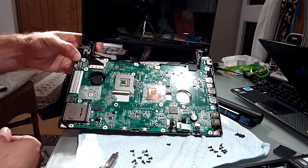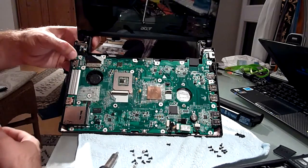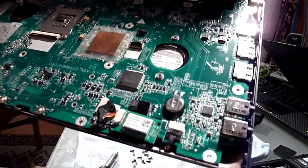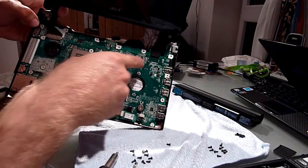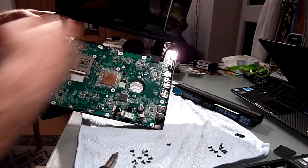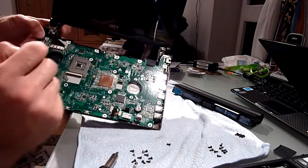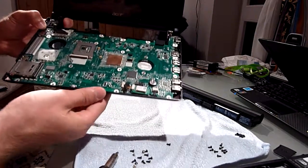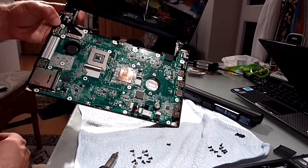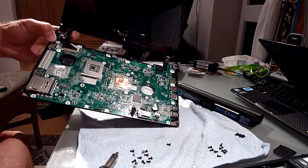The cooling is pretty good with a nice metal heatsink on the side — I haven't seen that on other netbooks, which is also why this device is a little heavier. The hard drive has a small hole to get more airflow from the top. Interestingly, there is a space for a SIM card reader here, with rubber protecting the battery area, and it looks perfectly shaped for a SIM card. Combined with the PCI Express slot space on the other side, a UMTS or 3G module could potentially be installed, so a 3G version of this device could be coming soon.